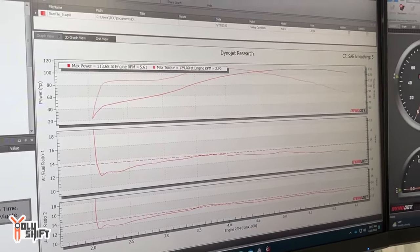I was looking at how you were aiming for the throttle position — you were missing that 90% throttle position. It's very hard to get it in there and hold the line. Sometimes if you're on the cusp it'll bounce. So I'm going to push that auto-tune session to the bike, let it cool down, and then we're going to do some pulls.